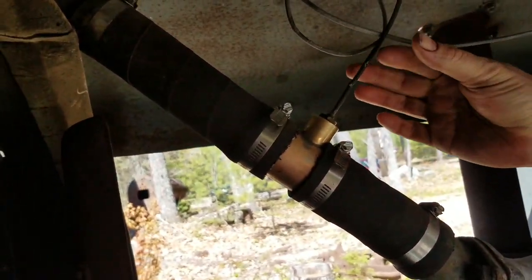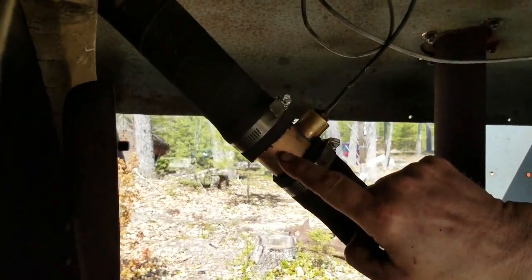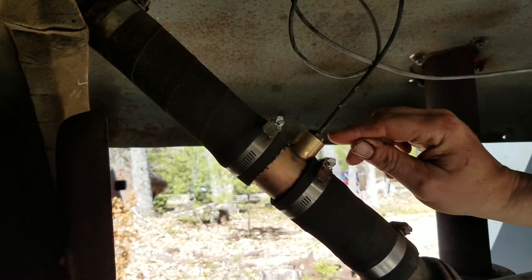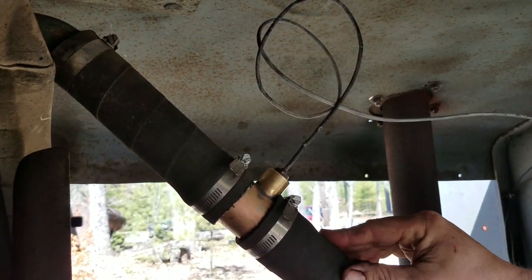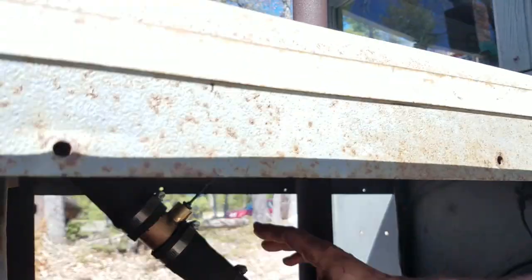You can see right here we've got the line coming in from the gauge. We took a piece of two-inch pipe and made a fitting, and turned a seat for the probe to sit on so it's all watertight, then soldered it all together, cut the hose and put it back. My cut's not exactly clean, but it works and it doesn't leak. Now we've got a full set of working gauges in the 1928 Lombard, which makes us very happy.